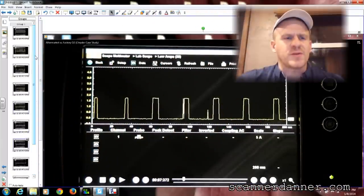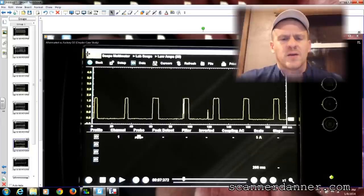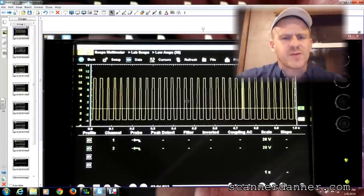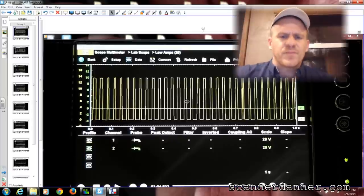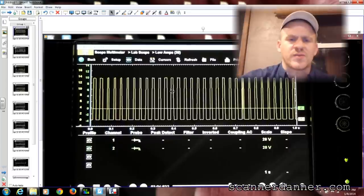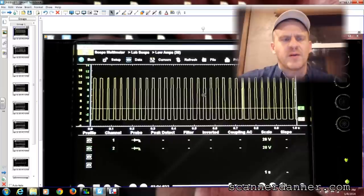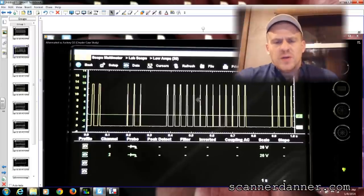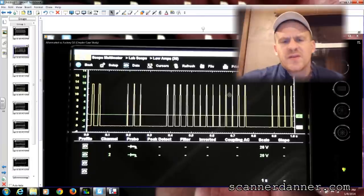Let me show you my desktop - I took some screenshots. I went back into my videos and took screenshots of both sensors and both heater circuits at different time bases. This first one is the original sensor in the car - the OEM Chrysler sensor, the one that was not replaced. This is the heater circuit shown in a zoomed-out view on a one-second time base. Then we have the replacement O2, the Bosch replacement that was put in - you can see the differences in the heater circuit controls, including the gaps.